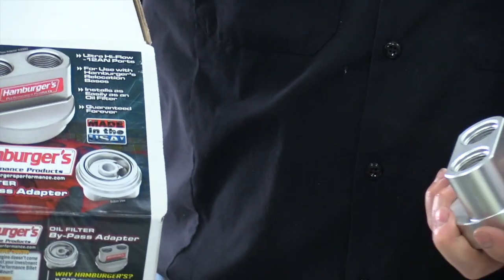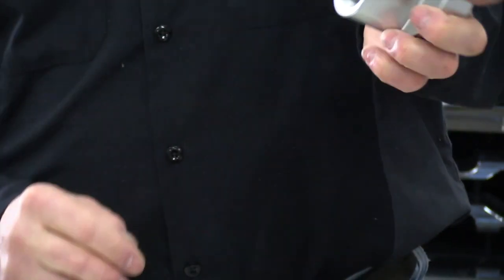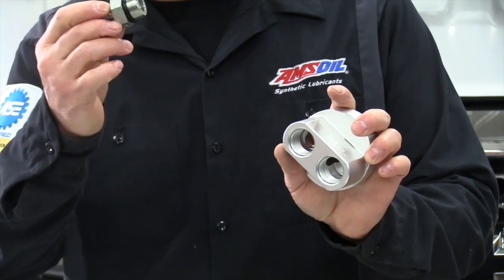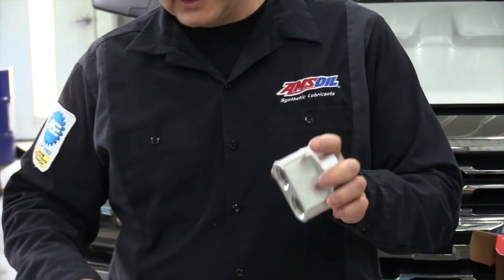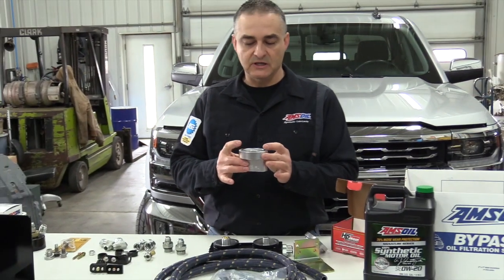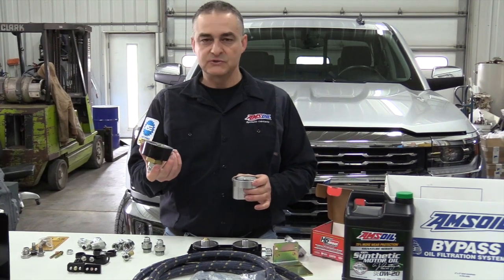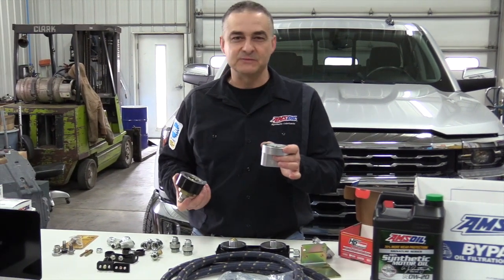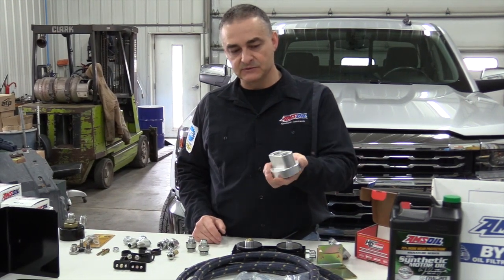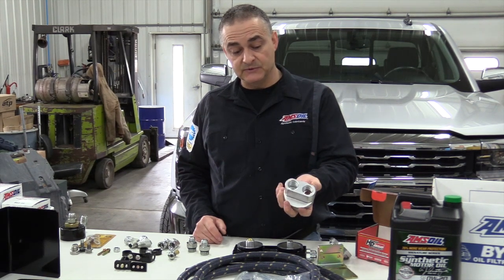This is a Hamburger's brand. You can see it screws on basically the same, but the ports are straight out of the bottom, and they're a size 12 O-ring, SAE O-ring, straight thread with O-ring seal fitting. This is going to push you down further and gets me to where I want to move my hoses. Everything just fits better and works better. This is not cheap — they're going to run you about a hundred bucks. It's billet aluminum, machined out of one solid chunk of aluminum. It's solid and I'm very impressed with how it looks.